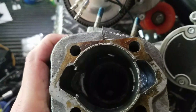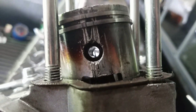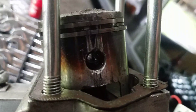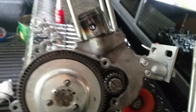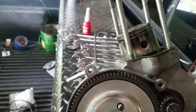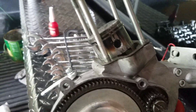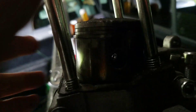What's up guys, well this happened today — I've never seen that before. A piece of the wrist pin clip broke out. There's still some in there, it's just hard to see, it's smooshed up in there. Some of it broke off, and I didn't install those wrist pin clips — it was ordered off eBay and the motor was already put together. I suspect they squished the ends together, which you're not supposed to do with these wrist pin clips.